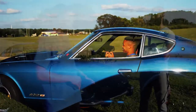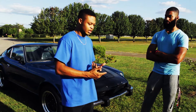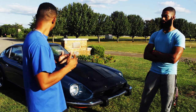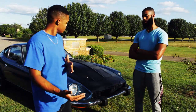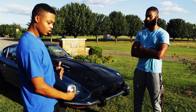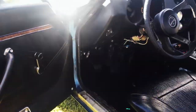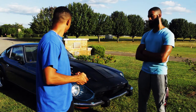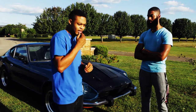I had to get a lot of stuff from CX Racing. They made the motor mount kits and the headers, and they have to be specific headers because on the driver's side the head exits at about a 45-degree angle, and on the passenger side it goes 90 degrees and curves back because there's a pocket there for the starter. That's just how it has to be designed. Overall it's a pretty easy build when you put it all together.